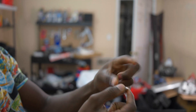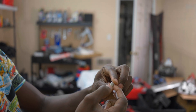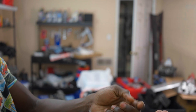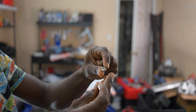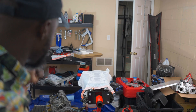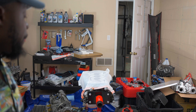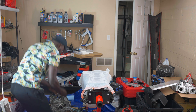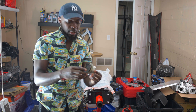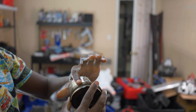I was like, okay, if this came from the rocker arms or lifters, why didn't I see anything on the head? I didn't see anything on the head and I just got confused. So I kept on going and since we already saw there was scoring on the third cylinder, I went and looked at the piston on the third cylinder. The piston itself from this side looks good — no issue at all.